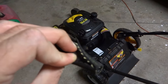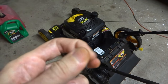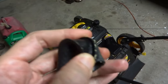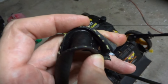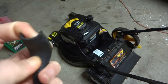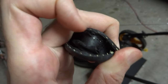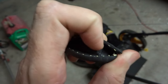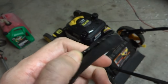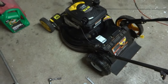The inside of the fuel line — this is the one that they sold the machine with — it's all falling apart on the inside and it was clogging. You see how it is? That's the inside of the fuel line, and it was clogging the whole fuel bowl. You just couldn't get it started. I took the gas tank off and it was clogging up.